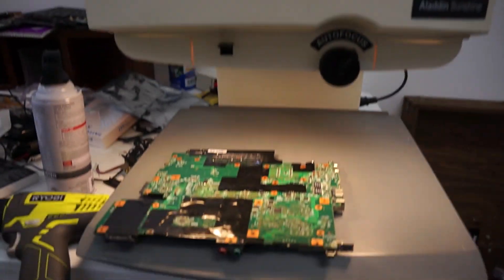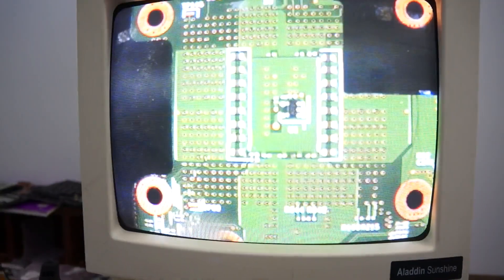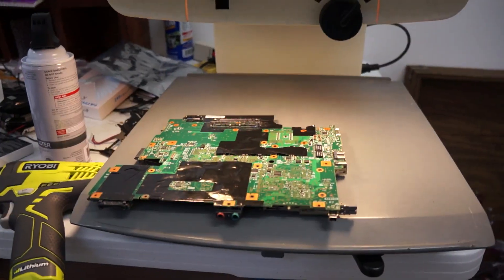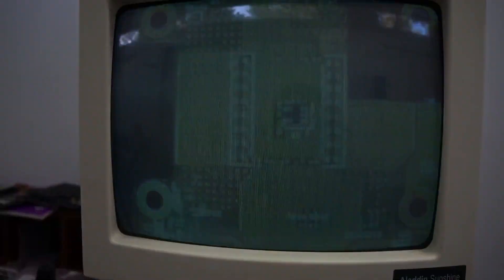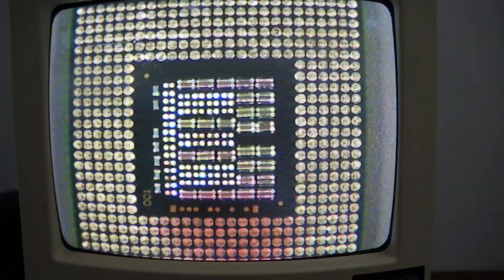From there I got my Aladdin Sunshine out, which is actually quite a nice machine — it allows you to zoom in and get close-up pictures, or you can even do some soldering work with it if you turn the autofocus off. That's a picture of the CPU socket; you do have to bridge one wire on that. That's about it for the soldering, but it is a little bit hard to solder, though it's quite a bit easier than the X200S. The quad-core chips generally look glued together in the words of Intel marketing, but they work just fine inside the T500. I haven't had any cooling issues really, except the fan started to give out about a day ago, but I don't think that's related to the build.